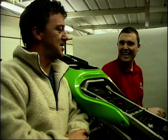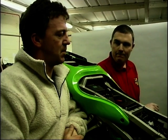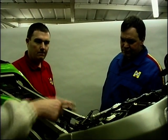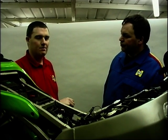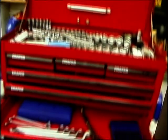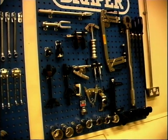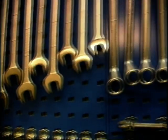So we actually take the trouble to keep assemblies as assemblies - don't mix up the clutch with the gearbox. Because one 6mm bolt looks very much like another 6mm bolt. So when you've got them all together in a box, it can get tricky. A tidy workshop is an efficient workshop. Exactly. Is there any particularly good bikes to work on - easier than others? This is a four-cylinder. What about triples, twins? All the Japanese stuff - it's pretty good, it's methodical. You don't need many special tools. There's only a couple of special tools you're going to need - a rotor puller and a clutch holder, really. Other than that, it's just standard 10mm spanners and 10mm sockets. Pretty universal.